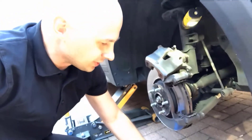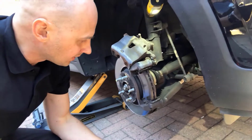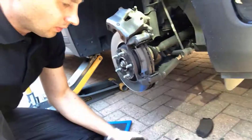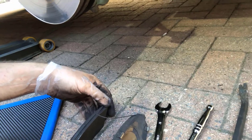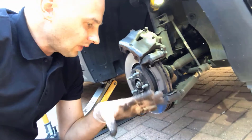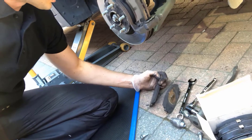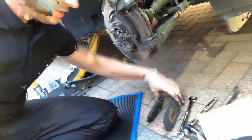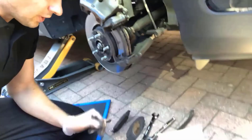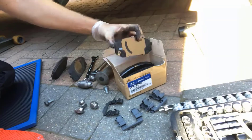I've now removed the plates that hold the pads in place so they don't rattle around. They act like spring-loaded plates, and there are springs as well that prevent the pads from rattling over potholes. When you release the brakes, they also move the pads away from the disc so they don't touch. When fitting new pads, make sure you replace everything that comes in the box — every old bit.